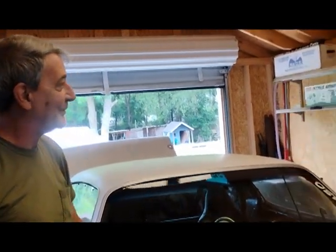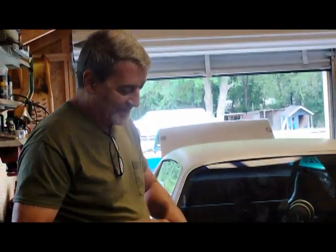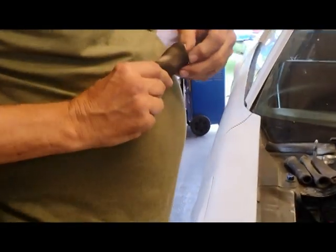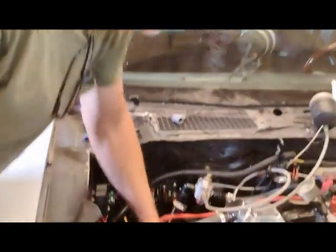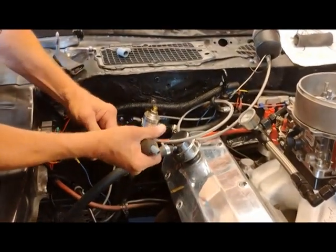And then when you're done, the most important thing while you're doing the bending is making sure that they're not touching the headers. They're not rubbing up against anything metal. So it's very critical. Doug runs these fancy little heat shields that go across your plugs there. I don't know what they're called. They protect your plug wire, so I just call them wire condoms. But if you watch, you just slide that up through there and get it slid through. And then you put your plug wire on.